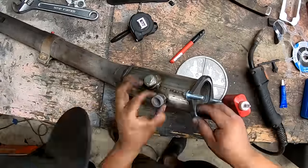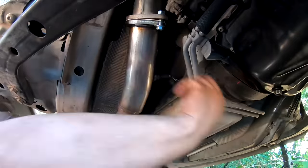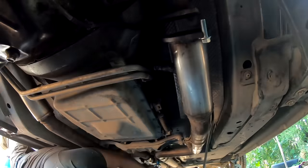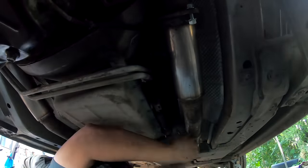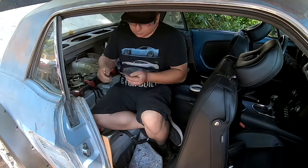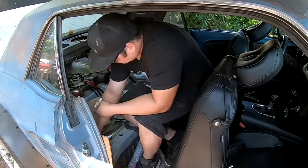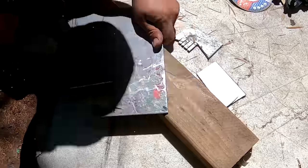With the exhaust, Oscar cut it off when he pulled the engine because it was going to be an epic pain to remove, and the car had not been running well at all. We had to fix the exhaust to get the rear O2 sensors in properly. Once we actually mounted the rear O2 sensors the car started running perfectly — it turns out this car gets really upset and does not drive well with the rear O2 sensors deleted and no real flow-through exhaust.